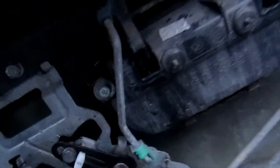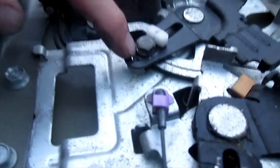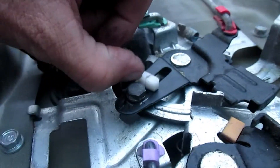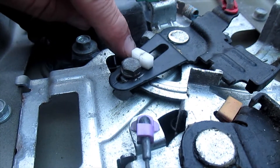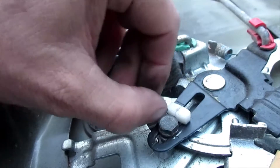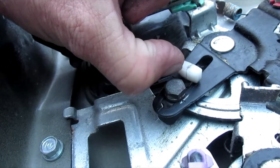What I did was install a bolt in there — it's a regular motorcycle bolt on the bottom. It's not going anywhere. It keeps this lever from falling back up in here. Once this slacks up enough where it's down at the far end of this opening, it will not open anymore. So I installed a 10mm bolt in there to stop that.